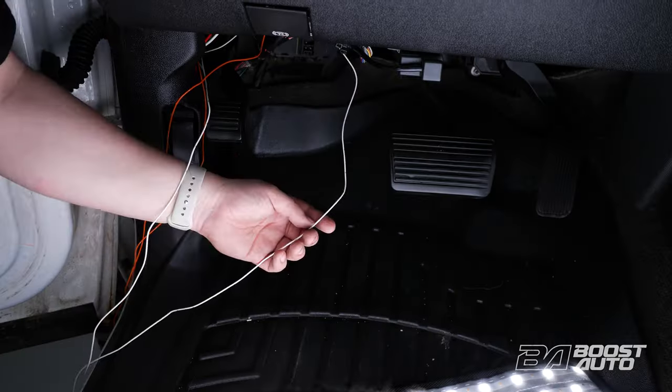Guide all your connectors to the other side of the door installation then proceed to the passenger side. The passenger side will only receive one wireless harness. Go ahead and connect the black 2-pin connectors with the blue and yellow wires to the corresponding connector. Then tape the black connectors with the orange wires out of the way as it's not needed for this application. Locate the black and white connector from your door harness just like the driver side and tap to pins 2 and 6 using the provided blue T-taps. With the connector tab pointing up, pin 2 is on the top row and the second slot from the left, and pin 6 is at the bottom right. With the T-taps installed, connect the red wire to T-tap at pin 2 and connect the black wire to T-tap at pin 6. Back on the driver side, take your wireless module and secure it to the door panel as shown or find an alternative position that works for you. Remember, the driver side module is the one with the two connector openings. You can secure the passenger side module in the same way. After this, proceed to door panel reassembly.